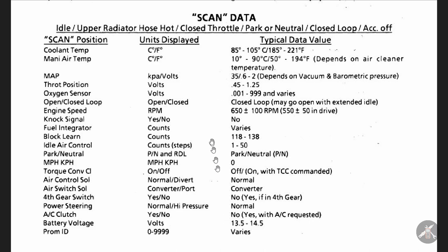My 1985 has to be put in what they call the 10K mode, which elevates the idle speed and changes some of these parameters. But by the time you get to 1991, I think you ought to be able to get data without having to do that. They expect the idle air control steps to be between 1 and 50 as pretty much normal. Walking down the list — battery voltage — if you have a normal operating system in park/neutral, this is where you ought to be.